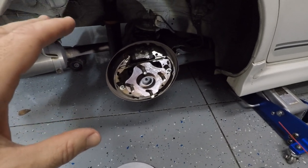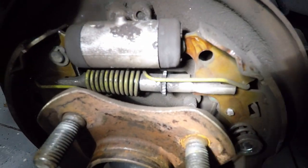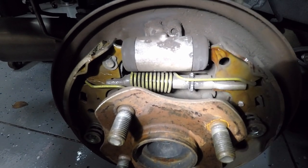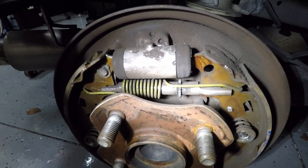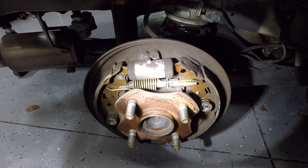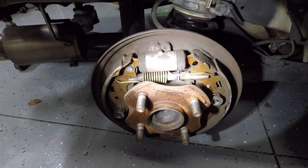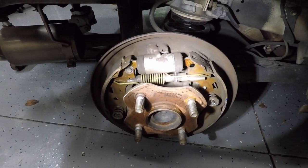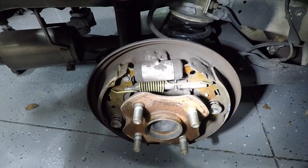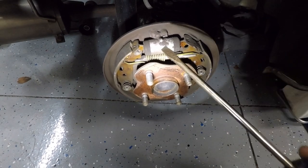Getting back to the job at hand — the brakes have an e-brake adjustment. There's a little rotating wheel, and by spinning it you extend the little arm, pushing the shoes outward. Right now with the e-brake off this has absolutely zero adjustment on it. The reason is the previous installer — me — didn't know what he was doing and just left it at zero, making the adjustment inside instead. What I want to do is spin that little wheel to extend the arm. I'll use a flathead screwdriver to make adjustments.